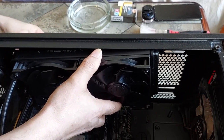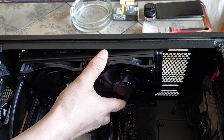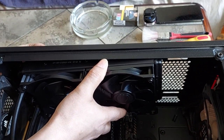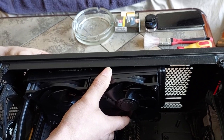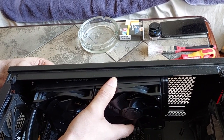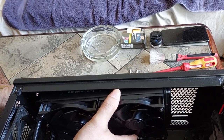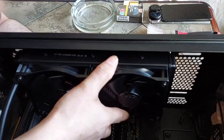This is a very small ATX tower, so there's not much room. This is the only place in the tower you can mount the radiator because it's such a small tower. Just put the screws in loosely so you can adjust the position when you place it inside.